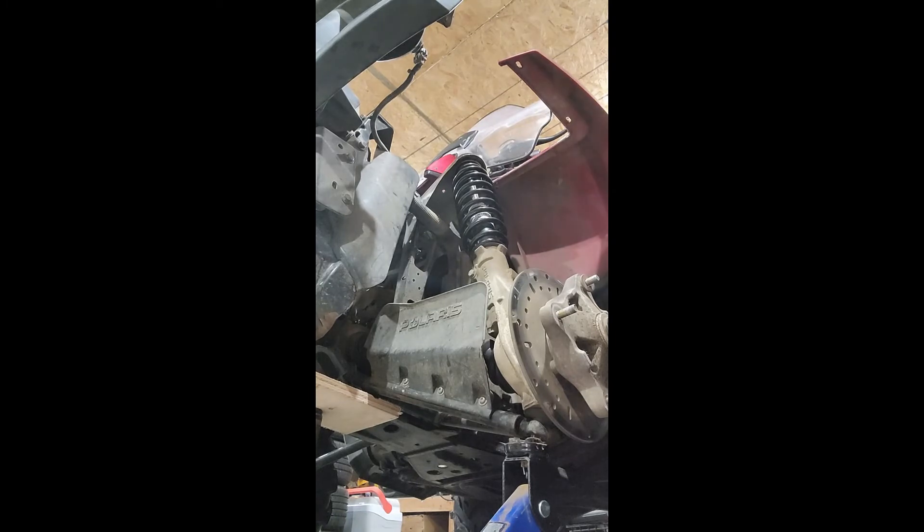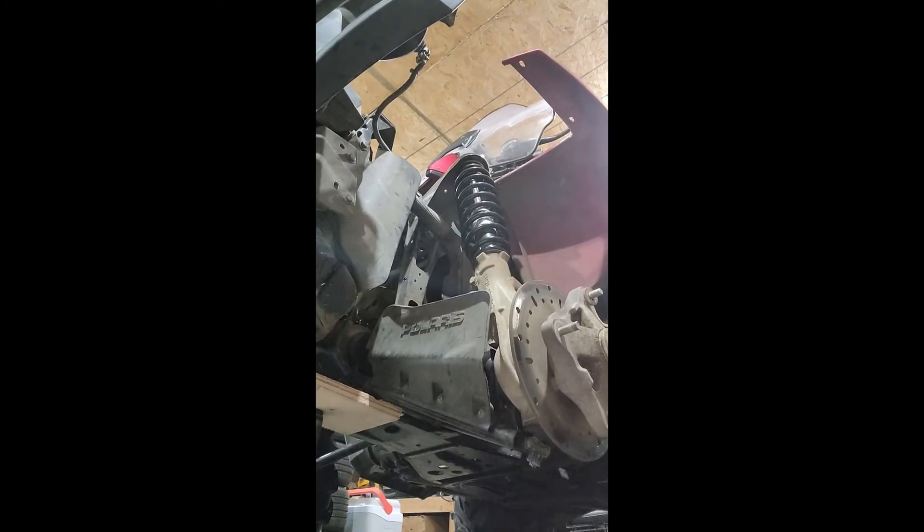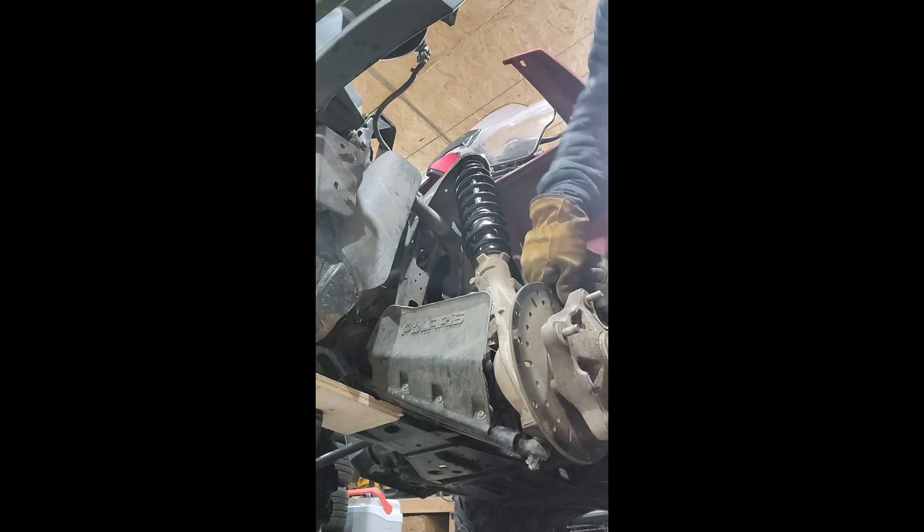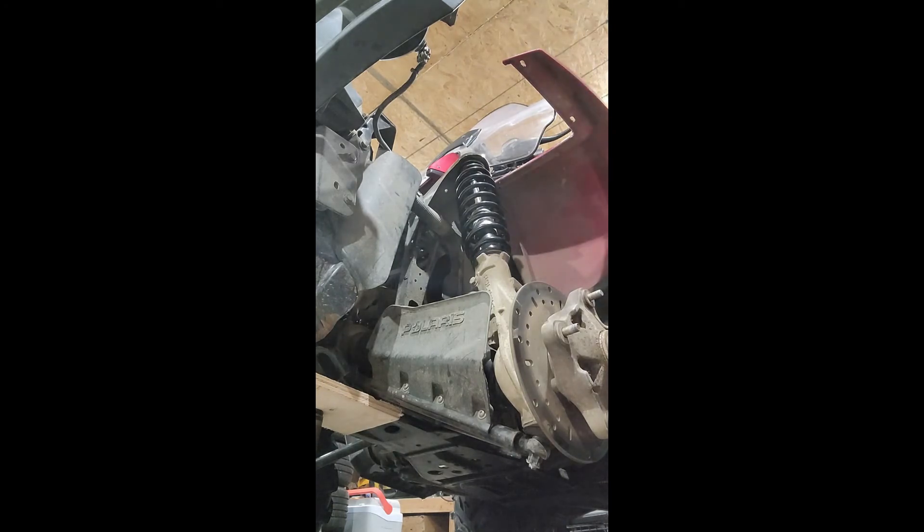Of course the tire helps too. There should be no movement in the tube — all good. Now it's just a matter of sticking the tire back on. I don't have wheel spacers, and I've got a wider front tire than factory — a nine-inch instead of an eight-inch Traction Nitro. I basically put two flat washers on each side, which brought it out far enough to get the wheel on without any rubbing. A wheel spacer would probably be better and maybe safer, though I haven't had any issues in the last three years.